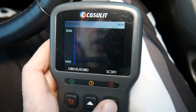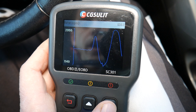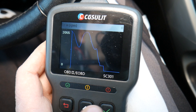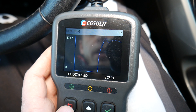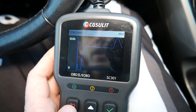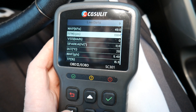With the engine running, I'm holding the gas a little bit at around 1500 RPM. I can rev it up all the way to about 2300, and if I let off it will turn off and the RPMs will drop to zero. I'll keep it at about 1300 to 1500 RPMs to stay steady. Now I'll go back — we need to go to the mass airflow sensor.